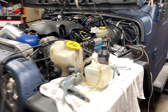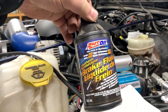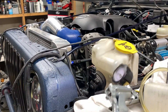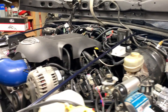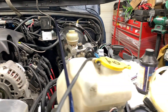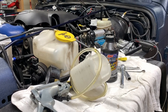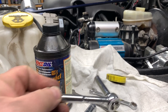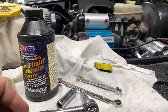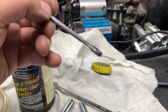Now I'm going to get ready to start bleeding. You want to check and make sure the master cylinder is topped up, plus have a little bit of fluid nearby. That is my vacuum bleeder right there — I'm going to apply about five inches of vacuum. And of course once you're bleeding, you've got to check and make sure that fluid stays in there. That's why I'm going to do a vacuum bleed. Now one of the most important things when it comes to removing the bleeder screws is always bust them free with a socket. Don't try to use a wrench, especially an open end wrench, because you're going to end up stripping it off. Always use a ratchet to bust it free.